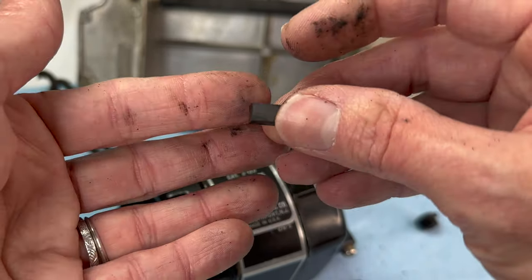Now this motor is not just going to pull apart — I do not want to do that. I want to slowly wiggle it apart. You're going to have three pieces: the band which fits around the outside, and the two ends. These wires are connected, so as I wiggle this apart I'm going to stop and keep pushing the wires in a little bit so I have more slack on the inside. If you twist, you can see it's starting to come apart. I'm going to stop and add that slack to the inside by pushing in the wires.